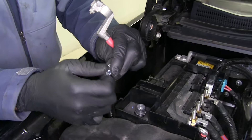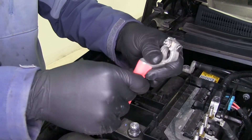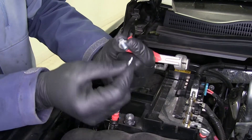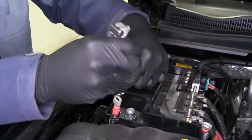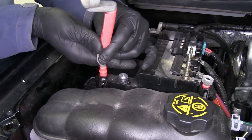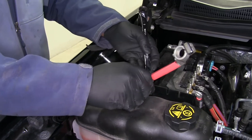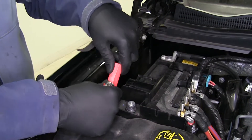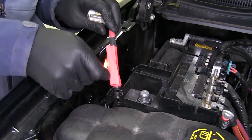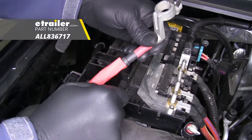Lift that off. Now to our battery post side we're going to add on our cable — don't forget to put your heat shrink on first. Bring our small bolt through our post, then take one of the provided star washers and place it on there. Bring that through our vehicle post and add on another star washer and then our nut. Use a half inch wrench and socket to get that tightened down. Slide that heat shrink down and over the bolt, then gently heat it up a little bit at a time to allow it to shrink down. You can use a lighter, a mini torch, or a heat gun.